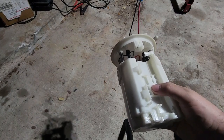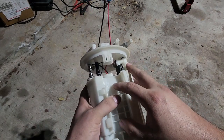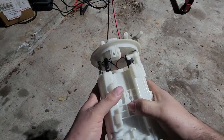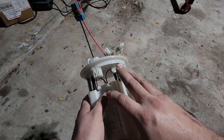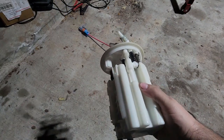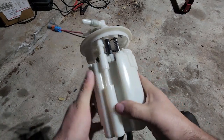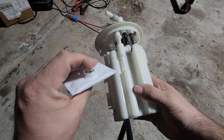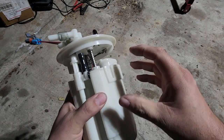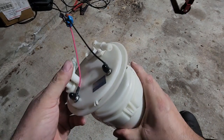because that would defeat the whole point of putting a larger pump if you can't actually get the fuel volume in there. And that would probably lead to extremely high amp loads of the fuel pump trying to suck through a smaller opening. And from what I read, there were people that had burned out multiple Walbros doing it in the factory housing, but they were using the method of cutting 3mm up, and they were probably running the sock filter on it, and by pinching it down here, that is probably the reason why they ended up burning the Walbro out, by it just trying to suck through the small openings and pulling so many amps and getting so hot.